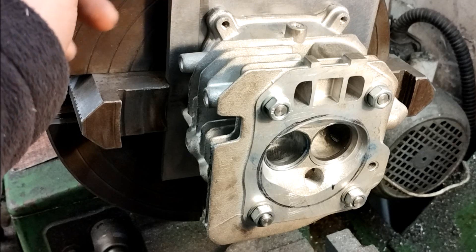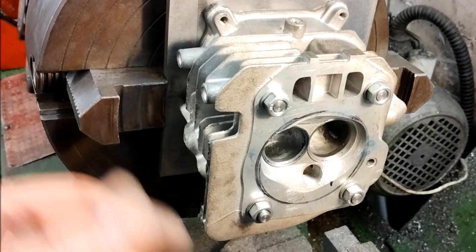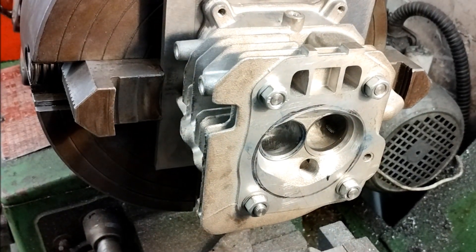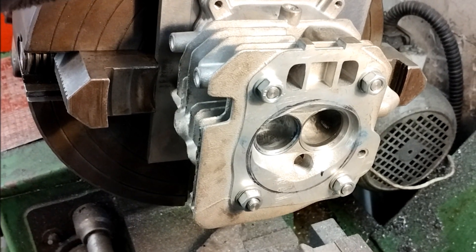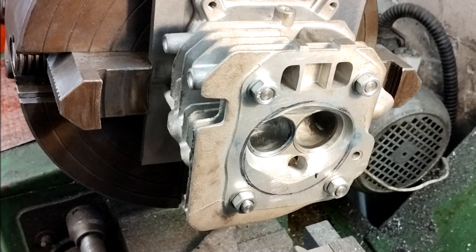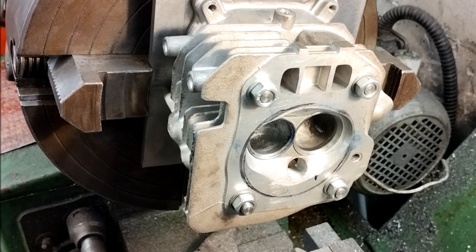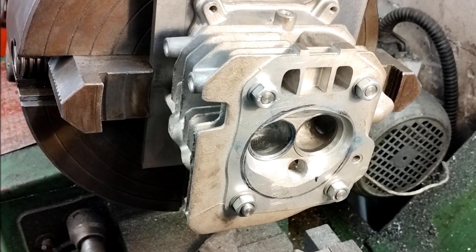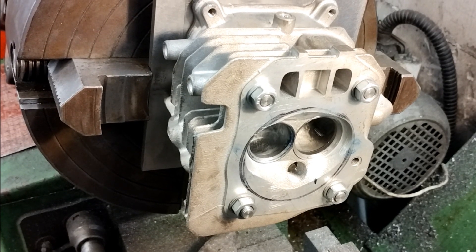I've got to do the spring seats - I've got a recessing bit. I won't know what that's going to be until I've built the engine to know if I've got coil bind or not. I would have coil bind because I've got a high-lift cam and double springs. That's the next phase, but that's going to be quite a bit later. This side's done - I'm now just waiting for the cylinder sleeve. I've phoned the supplier and that should come hopefully next week, but we'll see.